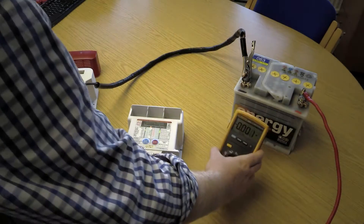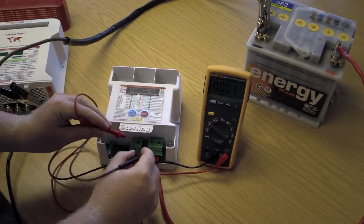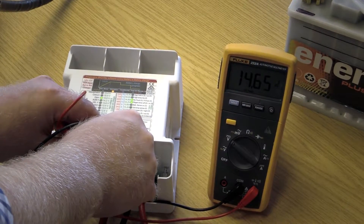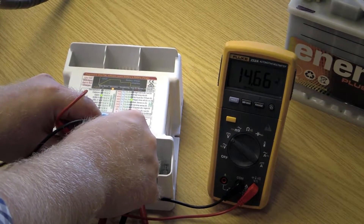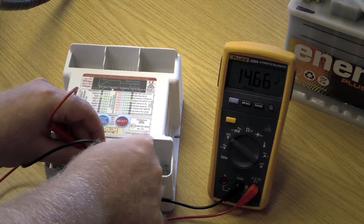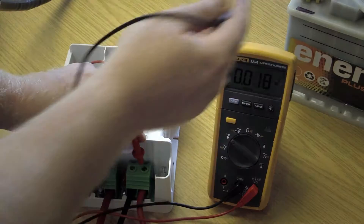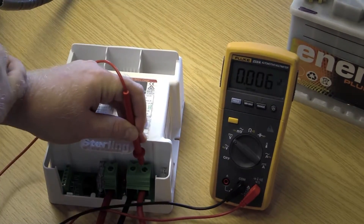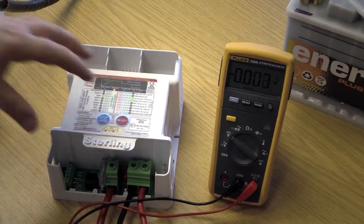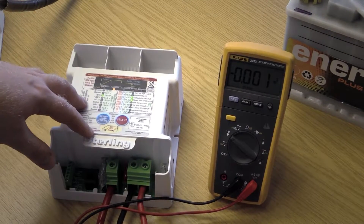The first thing to check is always about voltages. If you're having any problems with your battery to battery charger, measure your input voltage. In order for the battery to battery charger to fire up, you need over 13.6 volts. Once you've gone over 13.6 volts you can then go below it, down to about 12 volts if it's in default mode, but getting above that 13.6 volt horizon is the initial issue. Here I've got 14.6 volts coming in and 14.3 volts going out.